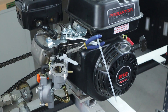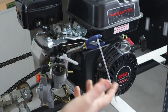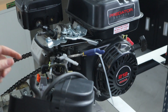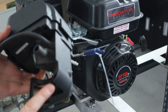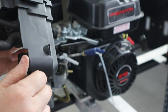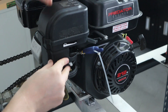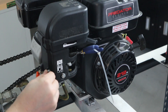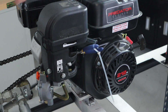For the remainder of the propane hookup, there's that plate we just took off — put the plate back on there. Make sure the gas line is hooked up and out of the way, and that you have everything secured. Make sure this hose gets hooked back up to your valve cover, and if you have a hose going to your gas tank, that it gets hooked up as well. For this particular air filter box, I had to actually cut a section out — just grab a pair of wire cutters and snip that section out. Hook up the rubber hose to the valve cover, push it in secure and tight, and make sure the other hose is in place as well.